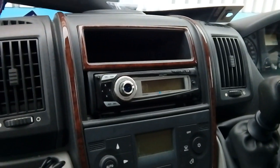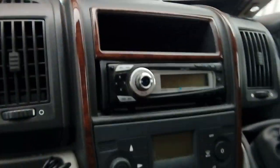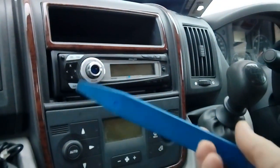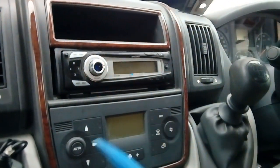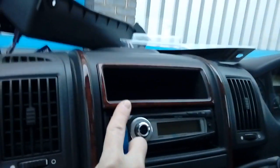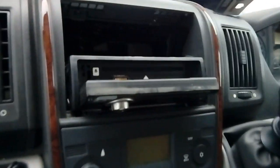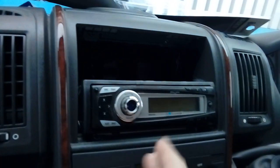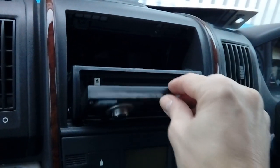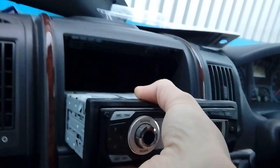Let's take the stereo out. To do that is really easy. You may need a plastic trim tool — a leverage tool like this. Don't use a screwdriver; you would definitely damage the dashboard. Don't use anything metal, use a plastic one. These are about a pound on eBay or Amazon, well worth investing in. All you do is pop the spacer out — most of them you just pull it out. The radio itself: most Blaupunkt radios have two holes each side and you push release keys in to remove them.